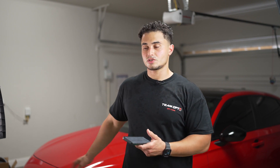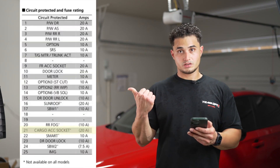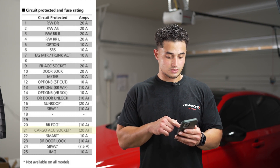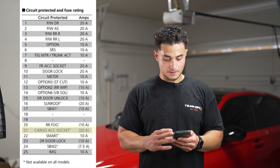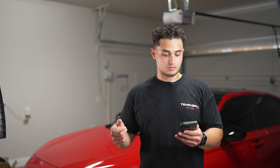Let's talk about the fuse I used. I'll put a screenshot on screen — it is fuse number 21, the cargo accessory socket, which is a 20-amp fuse. I extracted the 20-amp fuse, put it in the empty slot on the wire tap, and that allowed the lights to come on when I unlock the doors and turn off when I lock them. That pretty much wraps up this video — if you enjoyed it please hit the like button and subscribe. The install is crazy easy: put the lights where you want, route the wiring, and the hardest part is just routing the wiring through and taking apart the dome light a little bit. Thanks for watching — follow me on Instagram and I'll see you on the next one.